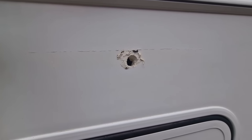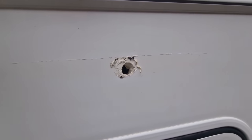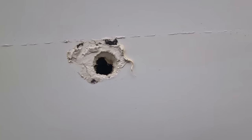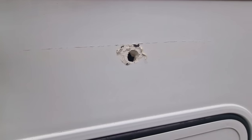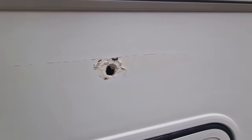We're all cleaned up and ready for the new light. I've left just a very tiny edge of sealant along the top. The reason I've left that on is so that when I put the new light on — it's always difficult trying to line it up and get it absolutely dead straight — that tiny edge of sealant is where the double-sided tape on the awning light sits just below, and that'll be the edge I reseal over the top of afterwards. That way I can line up the new light exactly where the original went.